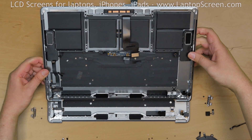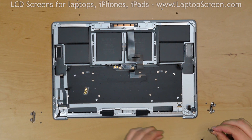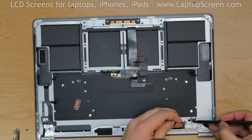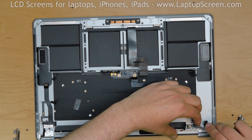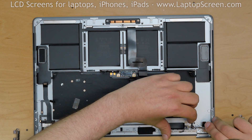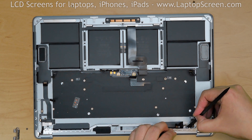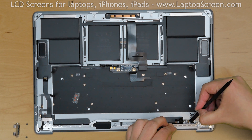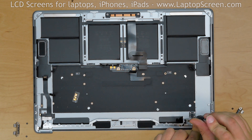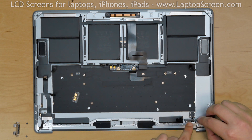Compare the original part to the new one and if every component appears to be transferred, place the new part on the desk. Now we will be reassembling everything back together in reverse order. Thread the power button cable from underneath. Replace the power button cable extension and using tweezers, reconnect the power button to the extension — it may need to be repositioned to connect properly. Once the cable is fully inserted, stick the extension and the power button cables in their appropriate locations, as they are mounted on adhesive. Using a plastic pick, lock the connector counter lever. Replace the power button back plate and secure it with 6 Torx 3 screws: silver screws go in the corners connecting to the body, and two black screws go in the center connecting to the button itself. Fold back the cable extension to the left and fold over the protective tape.